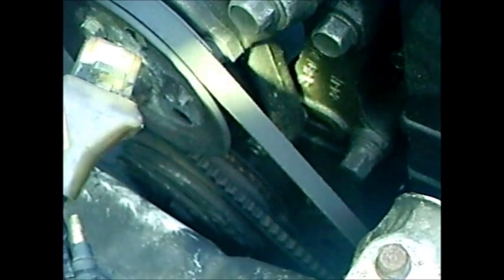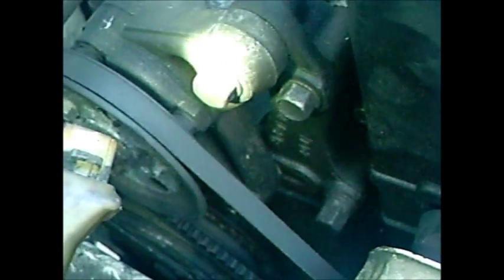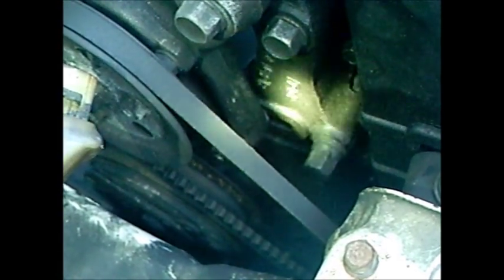So now we're going to take the power steering pulley off, which is actually very, very easy. So I'll hold the camera for that one. You're going to need to get to that bolt, which is right there. You'll see behind it a little slot right there, and that bolt. And then all you need to take off is this bolt, and then you just slide that piece forward, and this is your pivot point. Basically you're loosening the bolt so it can allow it to pivot, and that down there holds it in place. When you loosen that, you just push this forward, and the belt should just come right off. And down there in the crank, yeah, I can show you guys from underneath.